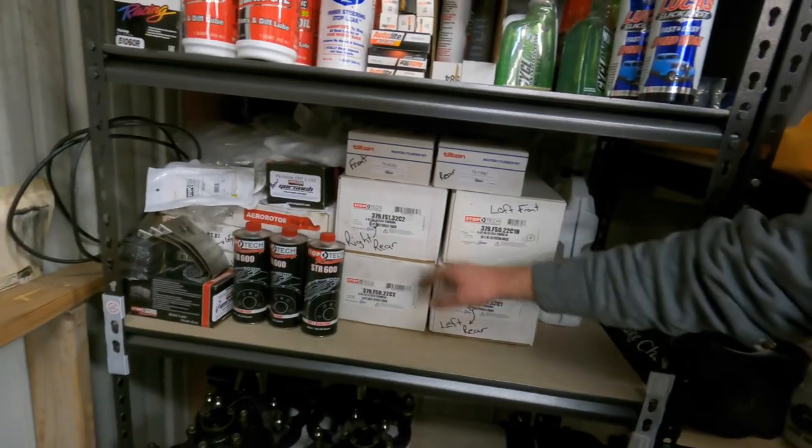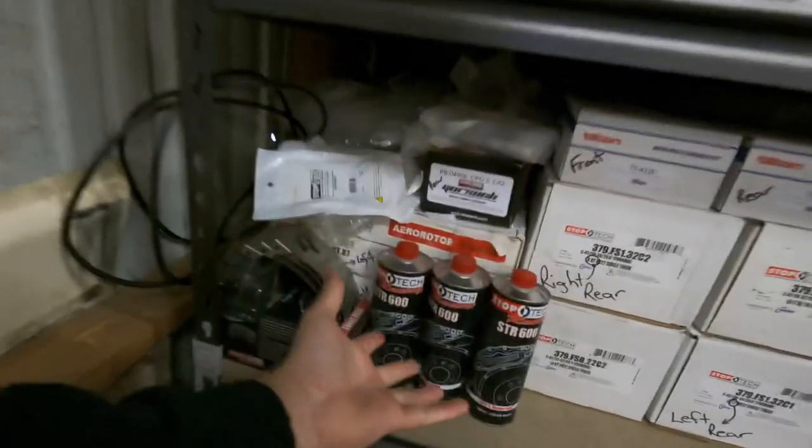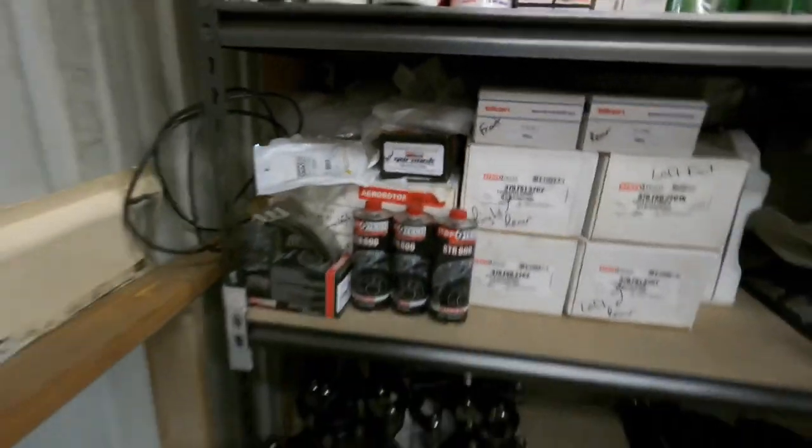There's old calipers there. Spare calipers. New calipers here. We're going to drain the fluid out. Well, we got the fluid. We got everything on hook. So we might as well be putting new, good fluid in while we're doing it, too. There you go. Gravity draining right now.